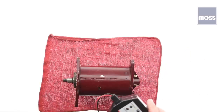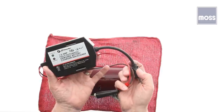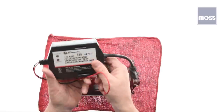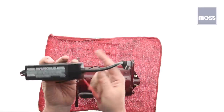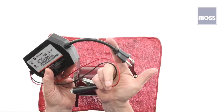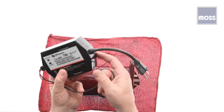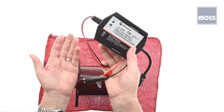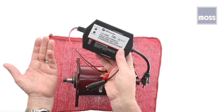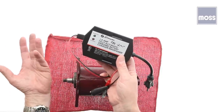This is Moss Motors 386245, an example of a maintenance charger or battery tender. As you can see, it's small — they're all like that. You can hide it, put it in an inconspicuous place in the car. It has a plug; you attach an extension cord to it so when the car is parked for a while, you just plug it in. The other end has a pair of wires — one goes to the ground of the car, the other goes to the battery or a cable going to the battery. If the car is reverse polarity, just simply reverse the wires.